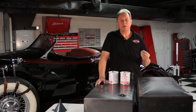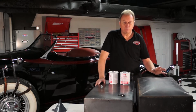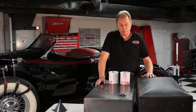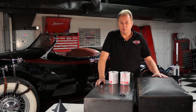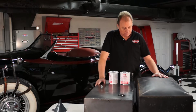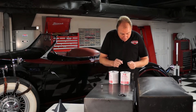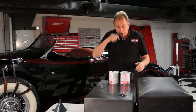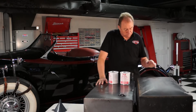Filled it with water again, had a little bit of a pinhole we wanted to fix, so we went back and did about a 1/4 inch weld, and all of a sudden a bit of a boom, and the tank jumped a few feet and scared us a bit. My friend who was welding was looking at it, and all of a sudden the tank just kind of disappeared. Had to lift his helmet up, saw it was gone. So we decided that we were going to have to get a new tank fabricated for us.